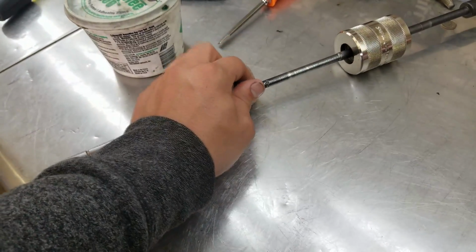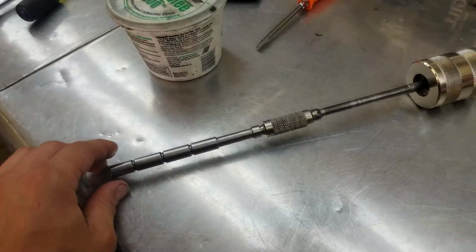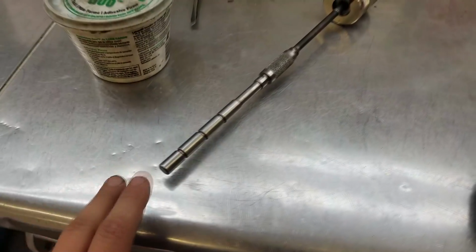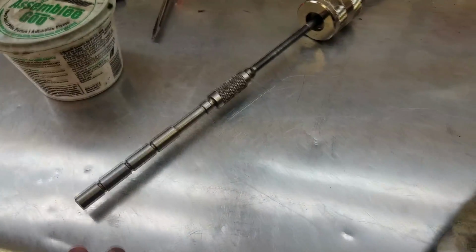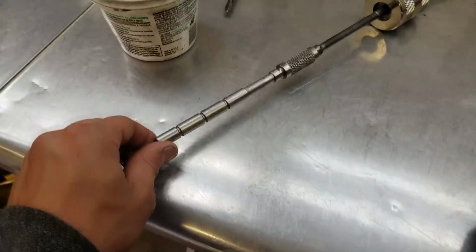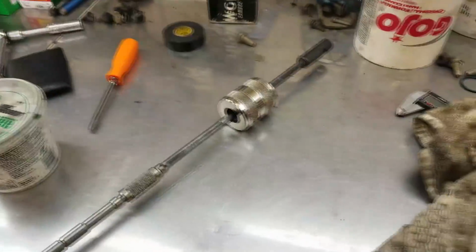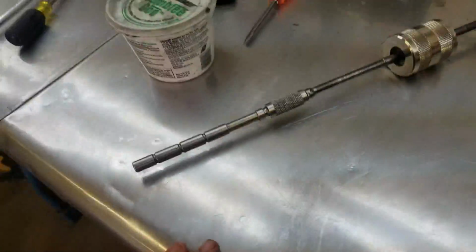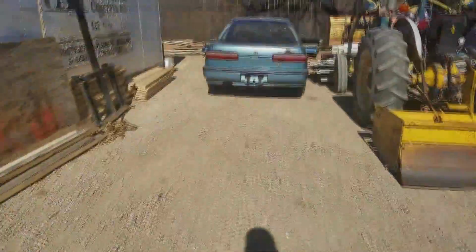This is a sizing tool for shift valve E, and that's why I had the valve body out of the truck again, because it has a valve that goes through that thing, or in the valve body, and it gets stuck. It's a common issue on these. So this goes through and kind of cleans them up, deburrs them, and yeah, so a really cool guy. Met me on a weekend so that I could borrow it. So yeah, really appreciative of that.